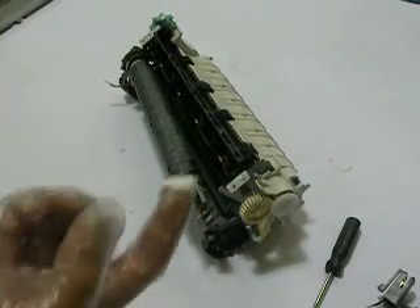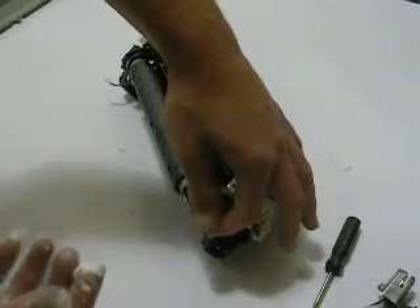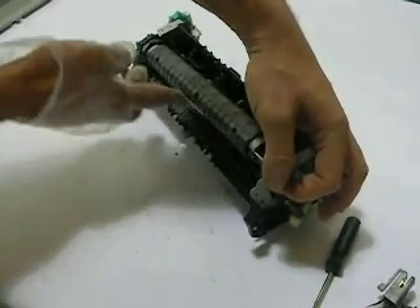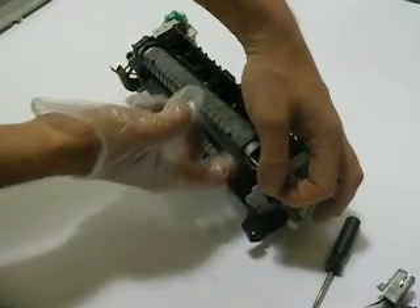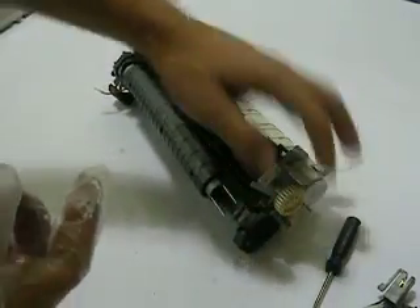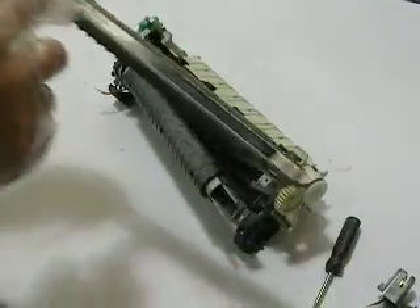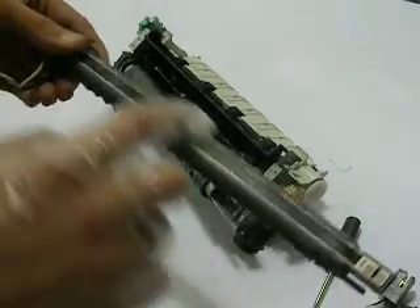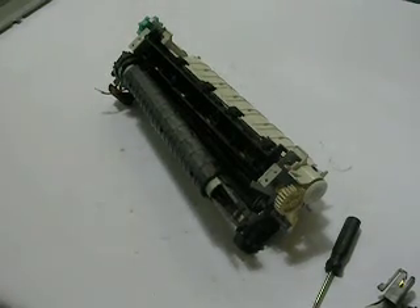What I like to do is I'm using a glove, and I put some lubricant right on the end of it. If you don't have a glove, we don't provide these — you can use a sandwich baggie or some saran wrap. You just don't want to get it on you. Now, some of the guys have used a petroleum product out in the industry, and that doesn't work. You want to stay clear of some of these witch blend lubricants that are out there. What I'm doing is I'm actually just getting this lubricant nice and good all over this element, real heavy. You want to build it up real nice and well. We're not too worried about the other side, but we want to get it all across this glass. At this point we have a sufficient amount of lubricant, and we're just going to go ahead and reinstall the sleeve.